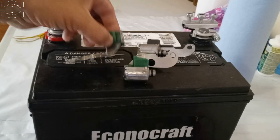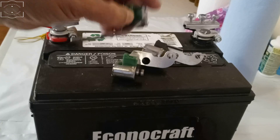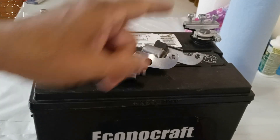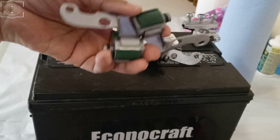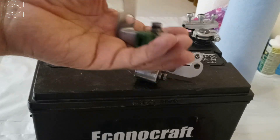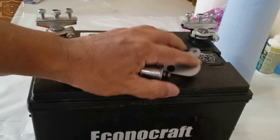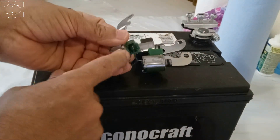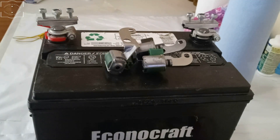Under the 2008 Toyota Corolla, if the solenoid I checked is good, it will click every time I apply 12 volts — because it's installed in the valve body. But once you take it out, it will click only once. The only way it will click again is if you completely disconnect it from the wires. That's how these single-pin shift solenoids work. Two-pin solenoids have a different testing method — I'll show that in another video.